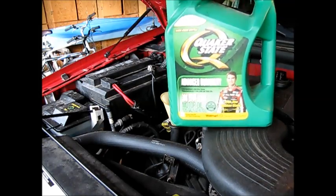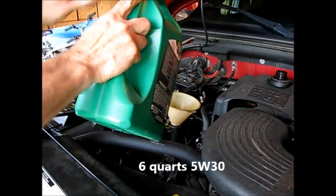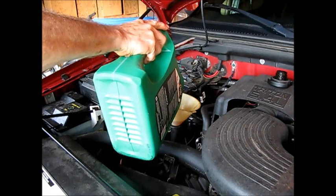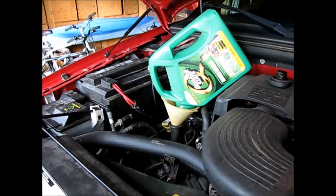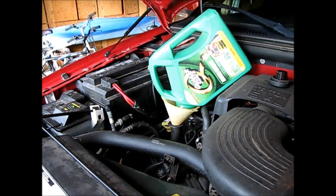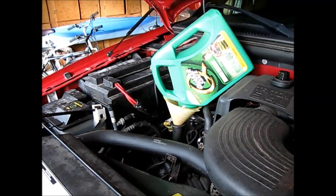Okay, now we're going to add 6 quarts of 5W30. Got 2 left in that one. Get 2 in, I'll add 4 more, and then we'll call it a day. Always good afterwards to run the engine just a little bit, and then check the level again after it settles down. After 15 minutes, the oil returns to the crankcase, and now make sure you get the level close to the recommended point on the dipstick. Thanks for watching the oil change.